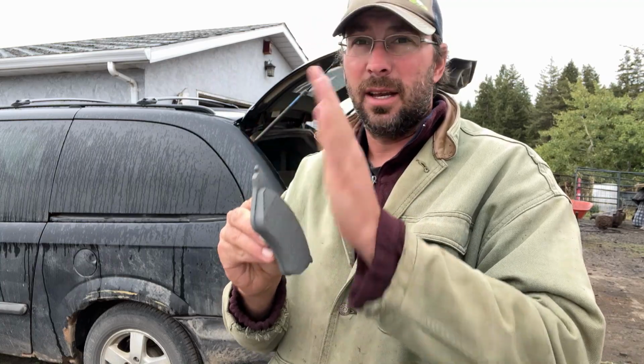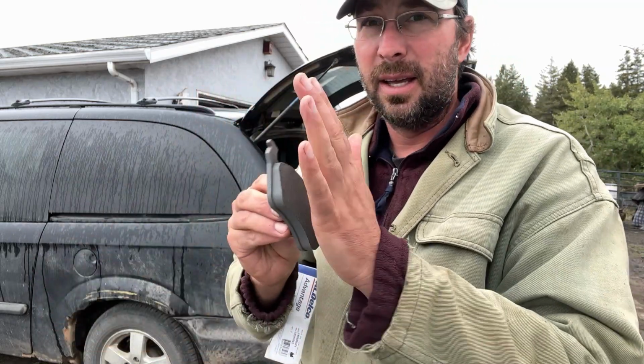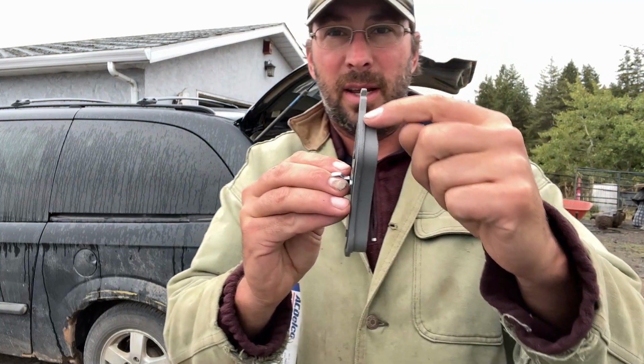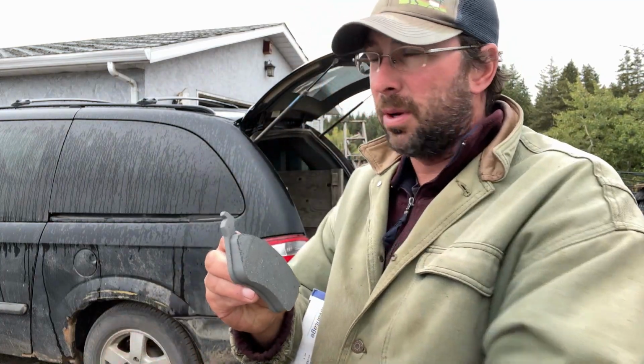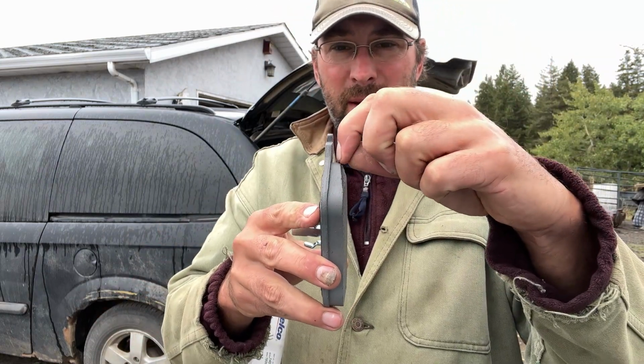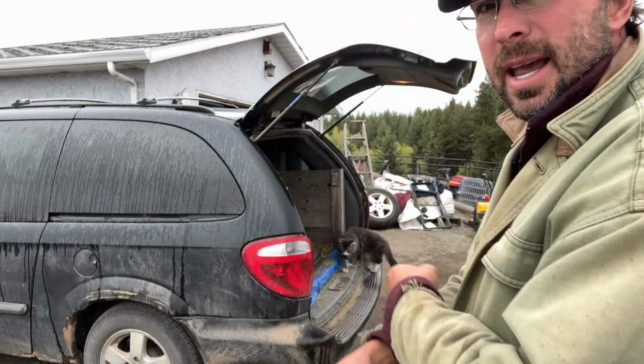It's designed to slough off a little bit, like a sponge, so you don't tear up the rotor. But unfortunately, when you wear down to this metal piece here, you chew up your rotors. So the insides have basically chewed down to this, but the outside still had probably 2-3 millimeters left.